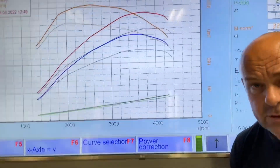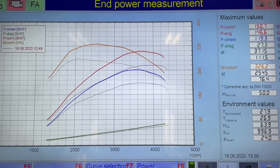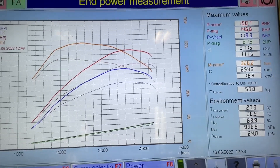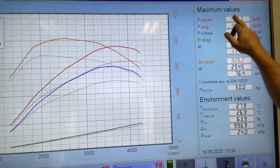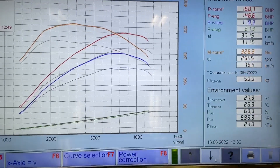This is the tune — with absolutely perfect tick over now, no smoke, running 1.1 bar boost, absolutely spot on across the full rev range. Tuning really doesn't get any better than this. I pulled the ECU, desoldered the chips inside — which are 27C010 chips — soldered them onto the ECU PCB board, removed them, put sockets on the PCB board, and replaced them with rewritable chips I can unplug and flash as many times as I want, giving absolutely perfect results. Correct tuning, no smoke, correct boost pressure, running correct pump voltage, correct pump timing. We made the magic number of 150 brake horsepower, and a more impressive 326 Newton-metres of torque — producing excellent torque under 2000 RPM with superb mid-range torque for a 1999 vehicle.